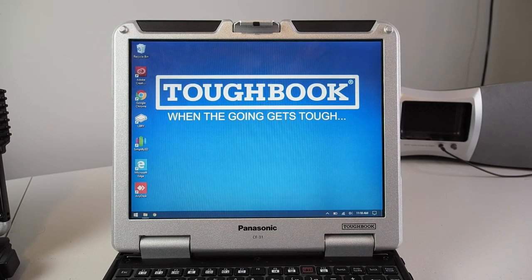They chose to, instead of use thermal paste, use a thermal pad to couple the CPU to the cooler. So those are not exactly the best thing for conducting heat away from it. It's done really for the purpose, at least my understanding, to make it more reliable over time, because thermal paste has a tendency to dry out and go a bit weird and kind of disintegrate over time, where a thermal pad, since it's mostly a silicone pad, just stays put and it's fine.